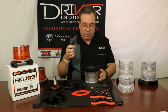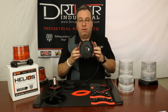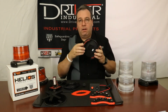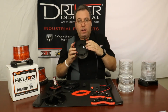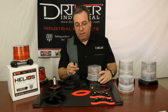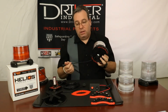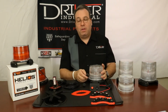So you would put that one on that side, and then this one on the other side. You're matching, and again, you do the same thing with the vacuum seal. And then on this side, you would put 3 bolts on each side and secure those in. So once you have your magnetic bases on, you have your cord running through that groove, and you have a screw here and 6 screws here, you are done with your beacon conversion from a permanent mount to a magnetic mount. Now obviously, if you're doing just the opposite, take your 6 screws out, remove your 1 screw, swap your pigtail out, and then use either one of these permanent items that will also come with your screws, and you'll be able to go.